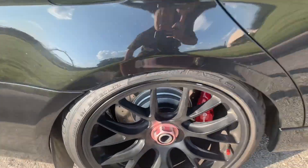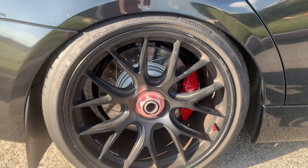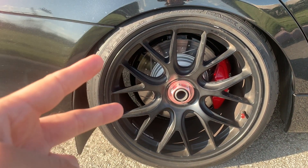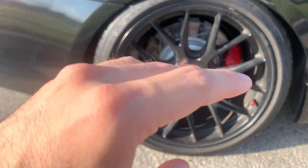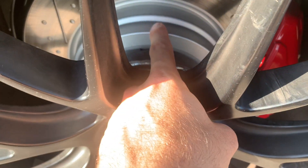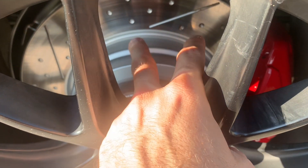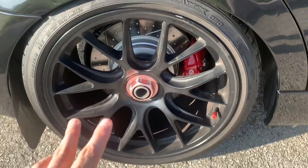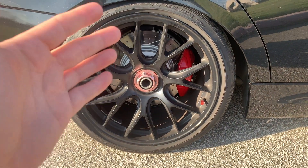Now on to the rear — it's a different story. I really love running blank rotors but since that wasn't applicable, I tried three options: the 135i rotors, the Z4 35 rotor, and an X5 rotor. All of those were blanks and they did not fit — they just didn't go over the hub. The rear hub geometry is different from the front so I had to go with M-Performance rotors, and on top of that there were no M-Performance rotors available due to the pandemic.